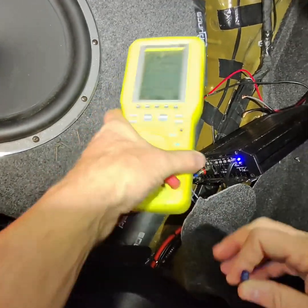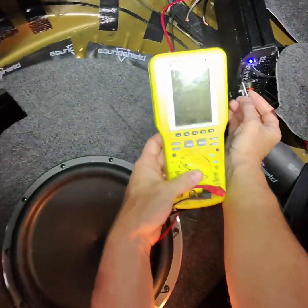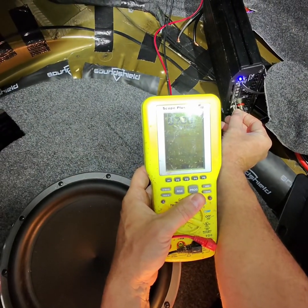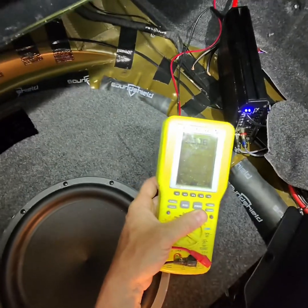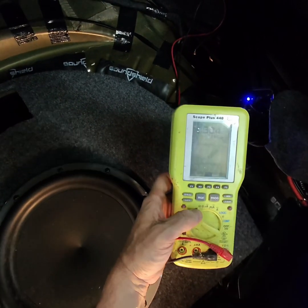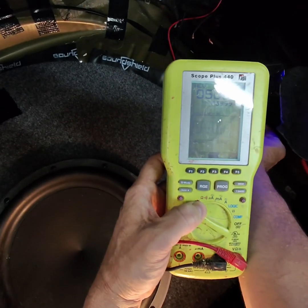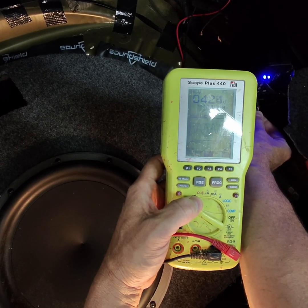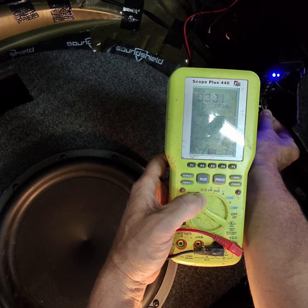We're gonna tune our sub amp here. We got the positive negative hooked up. This does have a clipping light, and we're running a negative 5 dB signal. So let's see where we can clip to. I don't know how well you're gonna pick this up. Let me turn my things off here. Alright, so that's a little bit squared off. Turn it down a little bit. Going up.